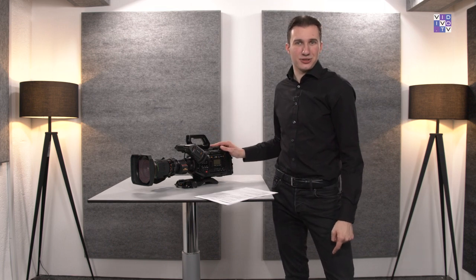There's also something interesting I discovered while testing. If you own a Blackmagic Video Assist — I personally have the 7-inch 12G model — it's possible to connect it to the URSA's SSD recorder using USB-C. The Video Assist will then recognize the inserted SSD as an external memory device. This will re-enable recording in ProRes 422 LT or even 1080i. Or you can just go for the most simple way and connect both devices using HD-SDI.